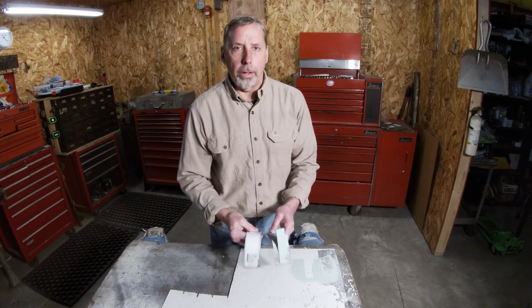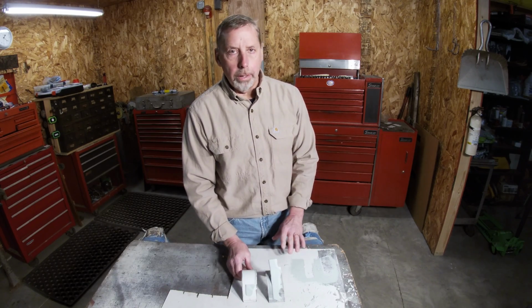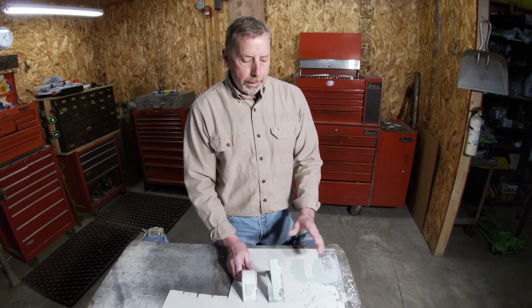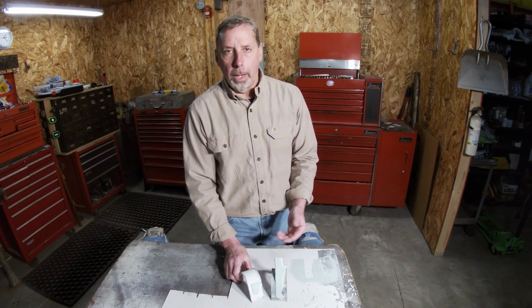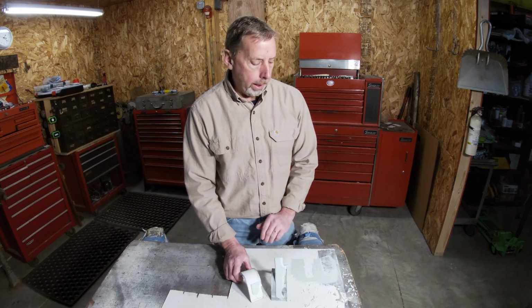I don't think this test shows enough difference in the two to make somebody say, I'm not doing it that way anymore, I'm going to do it this way. They're fairly close, and like I said, for years, we always used to grind everything down to bare metal. I haven't done that in probably 30 years, and I've never had anything come back where Bondo was delaminating from the painted surface, as long as it's prepared right, sanded, and kept clean.